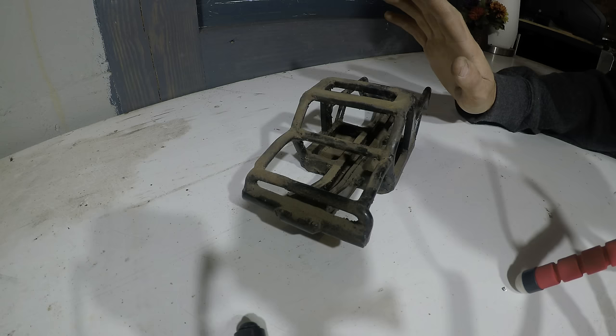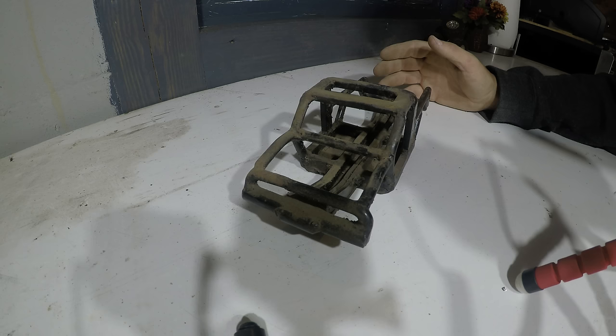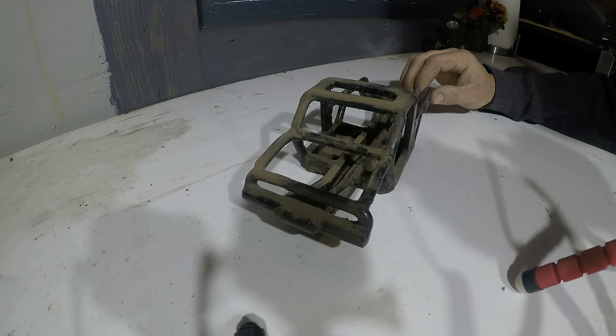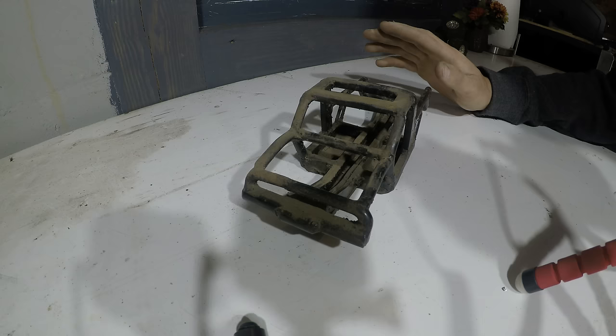Now take the batteries right out of the equation. With electric motors, you don't need a transmission, because they can run at a big enough RPM range that you can have just one gear and go from start to full speed, without changing gears a bunch of times like you would with a gas or diesel engine. And they can start from nothing, so you don't even need a clutch or a torque converter to ever uncouple the drive motor from the wheels. That takes a ton of moving parts out of the chassis.